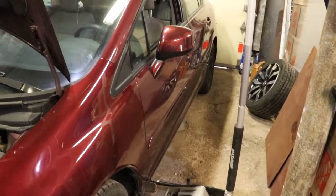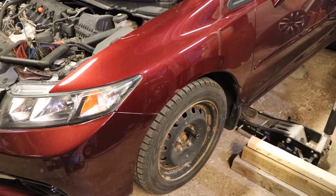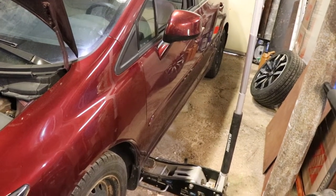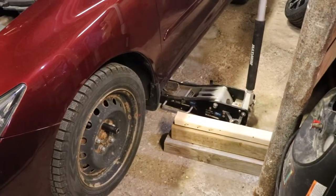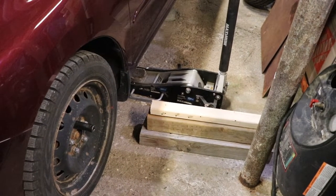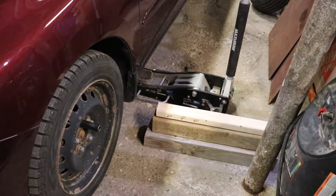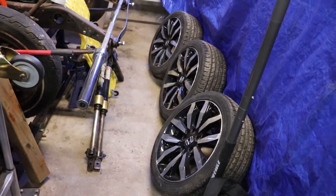We got the car into the garage. Not a lot of space to work in here right now, so I'll do one side at a time. I usually like to do one axle at a time because the brakes are the same on each axle. To do this job, you're going to need a 19mm socket, power bar, an impact gun. A lower profile jack — that's a three-ton jack, which is quite a bit more than you need. We might just use blocks of wood to support the vehicle.